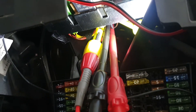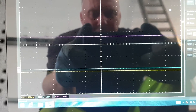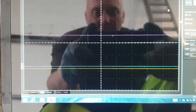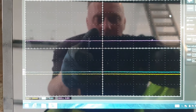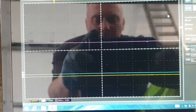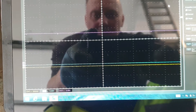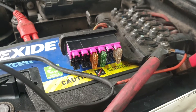If I turn the light on, you can see up here I've probed into the wiring behind it. You can see they rest at positive battery voltage, and one side of the control gets pulled down - and the fuel pump doesn't run. I had done more testing before this: when the fault actually occurred, we saw the amps drop out, so that's why I went to the control on the relay. I couldn't get it to recreate, it was just permanently off. So I traced it back to the fuse.